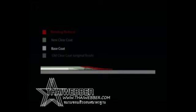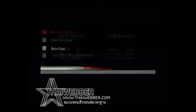So you kind of want to restrict a repair like this to a side panel, something down low ideally, but if you do it on a hood or the top of the fenders, you blend the clear there, you're going to likely run into some problems.